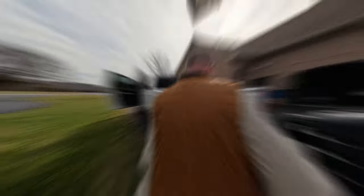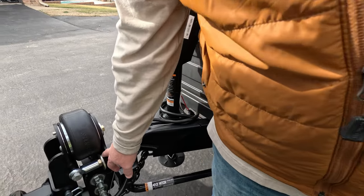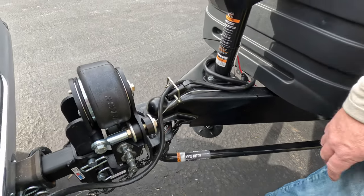I figured out my hitch issue too — the truck's running because I need it for this part. The instructions said most air pressure on this hitch is between 40 and 60 pounds, but mine needed to be at 25 pounds. I had put way too much air in, which buried the bushing. You just want this bushing right where my finger is, toward the spine — that gives you the travel on the back side for the hitch. You also need your torsion bars in to make it all work. I was being lazy trying to set it up without actually hooking it up. Now it's all hooked up — I think my torsion bar might be too tight, so I'll play with that adjustment as we travel.